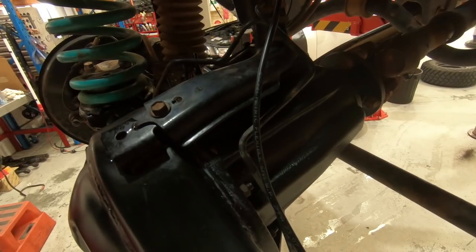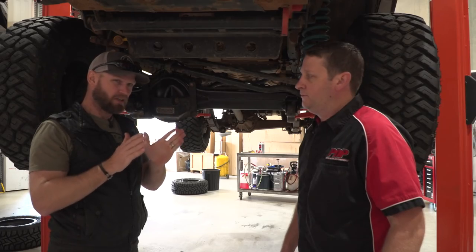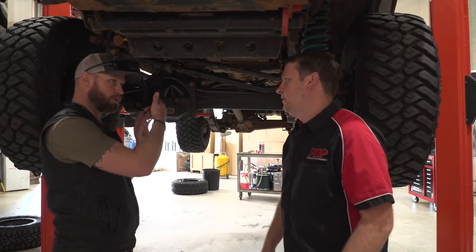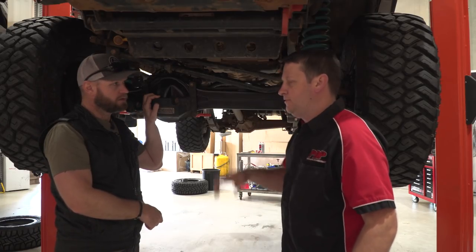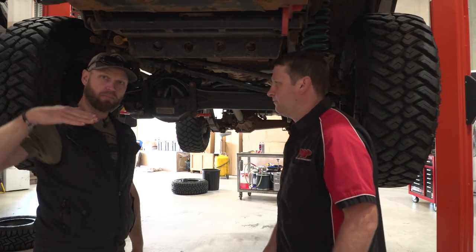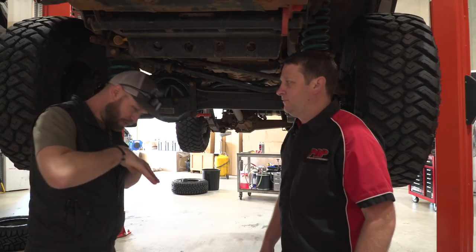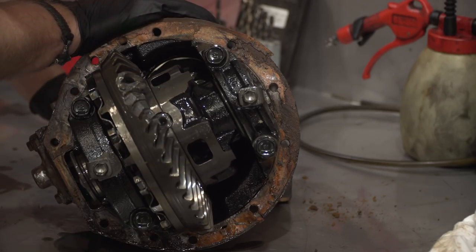People want to know how it broke. Leading up to this event: one, I accidentally drove 30 ks in full four-wheel drive on a highway — I'm not sure if that's got anything to do with it, it was a straight line. We had a noise we thought was a CV, and we changed that — it was only when it was locked in. I still had it afterwards. I reckon that was the uptake of just the tooth being bruised, and it was only now and then on the cycling when it hit that point, and only when it was loaded. So there was a bruised tooth, and then obviously it had its last hurrah and let go — and that took about a year and a half. We were trying to find it and couldn't. Then I loaded it up — I was trying to beat someone else's time on a training course, drove down a hill, let it coast, then smashed it into first gear low. All that pressure and force and weight on the front — that's when it went bang. I was stuck in a hole in two-wheel drive but I managed to get out.